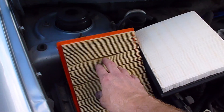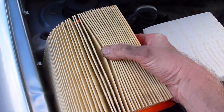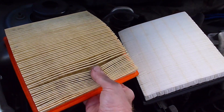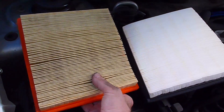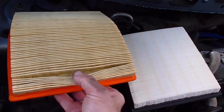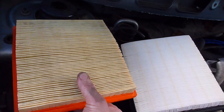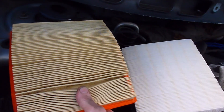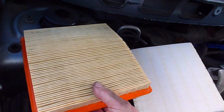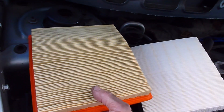Now if you look at the one I'm removing, this FRAM filter — yellow is its natural color — it really does not look very dirty. You're supposed to replace these every five or six thousand miles. This filter has 13,000 miles on it and it looks pretty close to new, just a little bit dingy. But looks can be deceiving, because all the fine dust particles it's filtered out are clogging all the little holes in the filter. So if it looks visibly dirty, that usually means it's too far gone. Don't trust the appearances of your air filter — go by mileage. And if you're in a very dusty region, you want to replace it even more often.